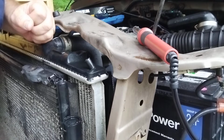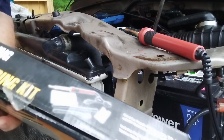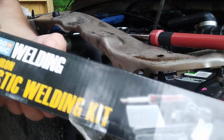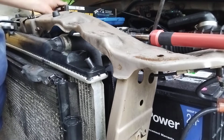so I decided that I was going to try to fix it, and I went out to Harbor Freight, and I got one of these Harbor Freight kits. It says plastic welding kit on here, right? So it's a plastic welding kit from Harbor Freight. It comes with a bunch of stuff inside of it, wire mesh, a holder, some of these little bars of plastic, and you would think, oh, that's the plastic I need to fix this stuff, but it's not. That's actually ABS plastic. So it is not the right plastic, but after doing a bit of research, I found out that